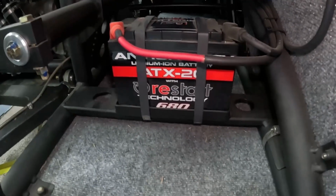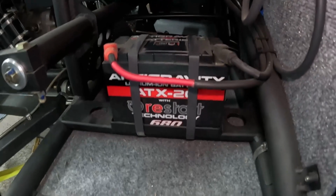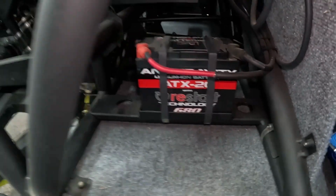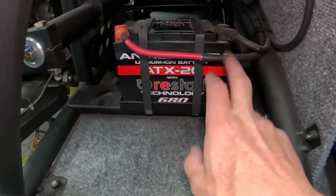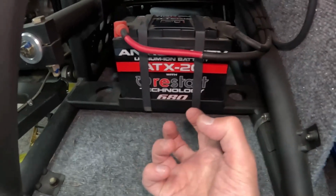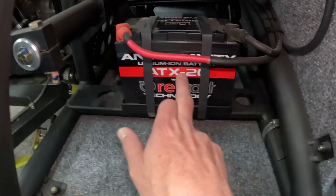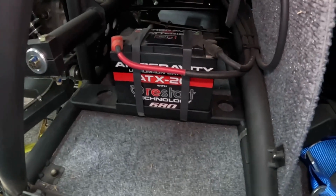It's done it to me when it's been in the 20s, but it's never done it to me when it's in the 40s. But somewhere around there, the battery voltage gets low because of the cold weather. And then when you go to crank it, when you put that draw on it of the starter, it takes it down too low and the BMS shuts it down. So it acts like you have a dead battery, but it's not really dead.